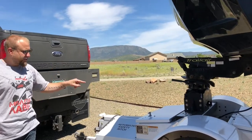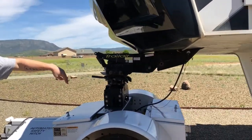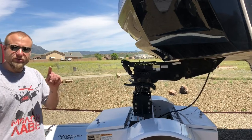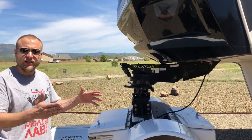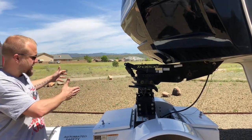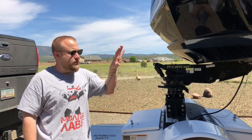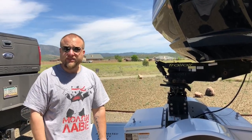This hitch basically has an extra axle — a one-ton truck axle. It actuates based on your turn signal, so if you hit your left turn signal it will free the axle and allow the trailer to swing way out to the side. It also has hydraulic brake controllers, which you can use for your camper if you wanted to do that, and it hooks up to the back of the F650.